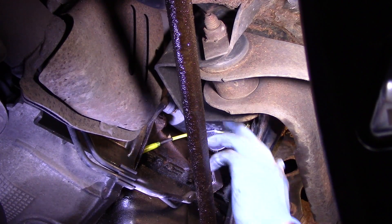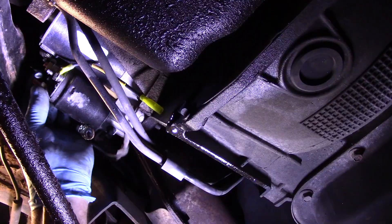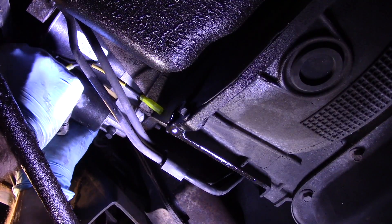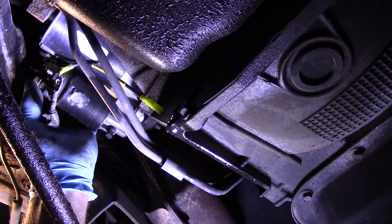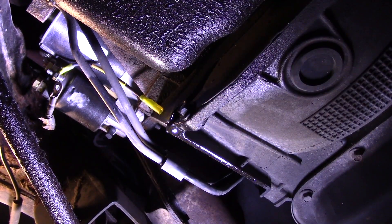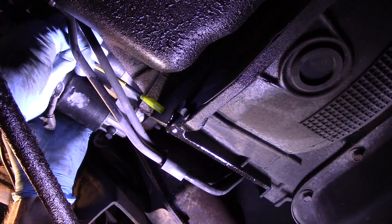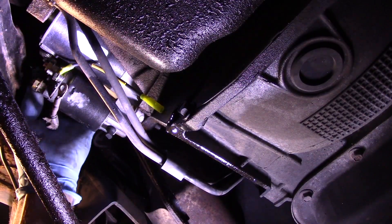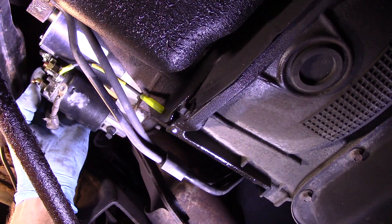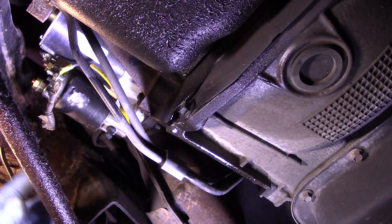All right, all three bolts are now tight. We're going to reconnect our other leads on here. We're going to tighten on the main lead first, just like that. Now this one here — you want to be careful not to tighten it too tight because if you tighten it too tight you can break the stud. So we're just going to snug it down a little bit and then just go a little bit more. I was holding the wire up so it doesn't rotate. Now we're going to cut this and splice it together, so let me get my cutting pliers.